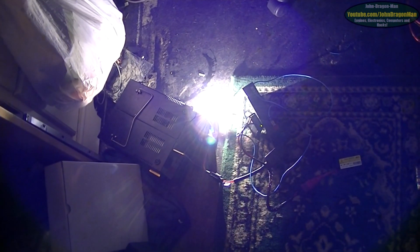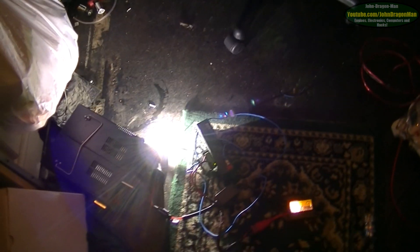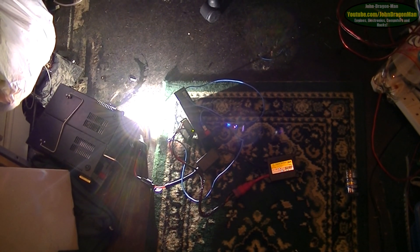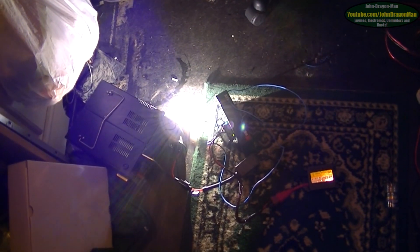These are great for stepping up 6 volts for an old-fashioned motorbike so you can stick good lights on it. That's what we're going to do — we're going to stick this on our old 6 volt MT-50. We're going to make a plate up, change the headlighting, and just tee off the headlight connectors to get it running. The DC-DC converter is powerful enough to run everything on the bike — all the indicators, the backlight, brake light, horn, tail light, side lights — all of it.